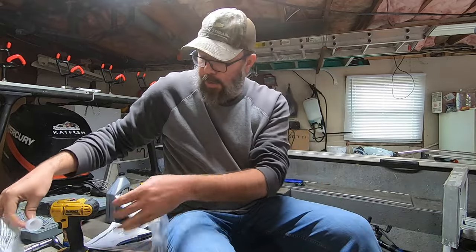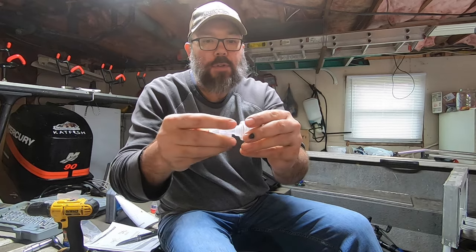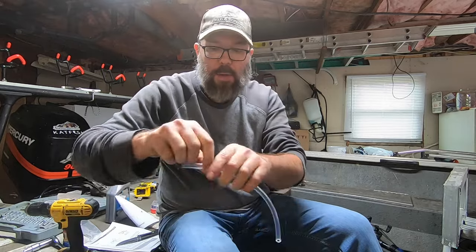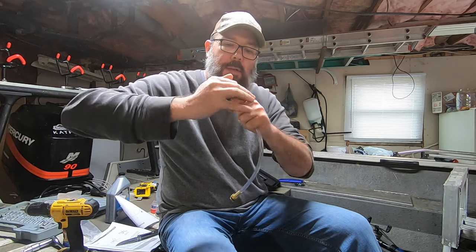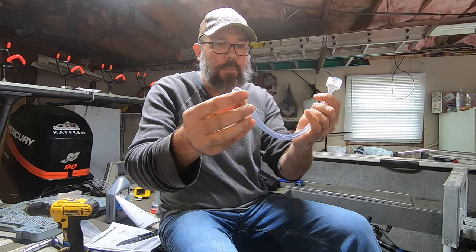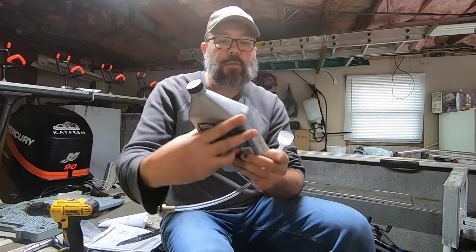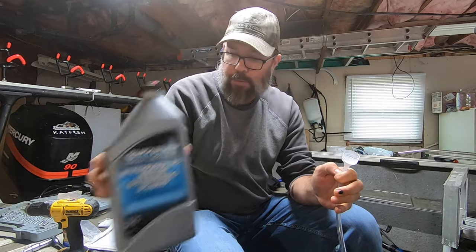And it also comes with this little cap that fits your oil bottle. Take the lid off. This is going to go down in the opposite end of this. This will screw into the helm. This will screw onto the bottle. This kit did not come with steering fluid, so I bought 2 quarts of this Quicksilver hydraulic helm steering fluid.